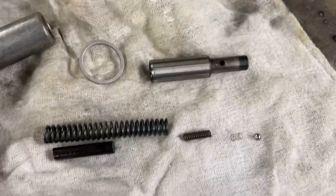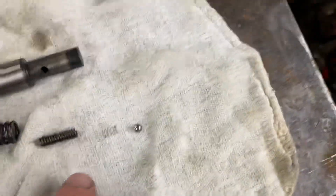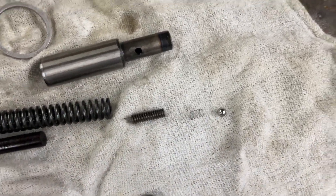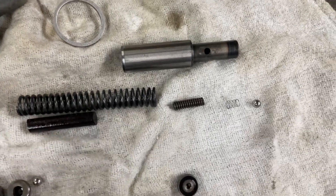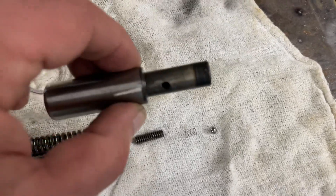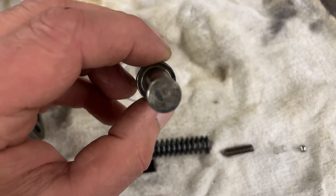The failure started with the seal — that rubber O-ring — which no longer sealed the inside to the exit hole where the bleed screw sits, with its pressure release system between these two springs. That's how it lost oil pressure. Then the spring weakened because it is bent and stressed, and no longer pushed the plunger all the way out against the rail. Hence the ping noise when you first start — then the oil pressure comes in, pushes the rail suddenly out, which also coincides with those score marks.